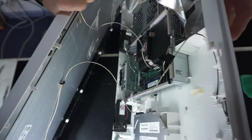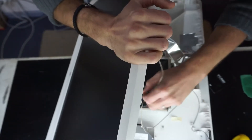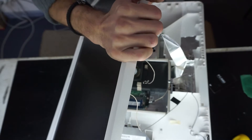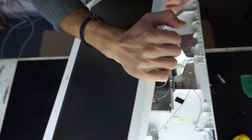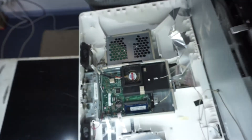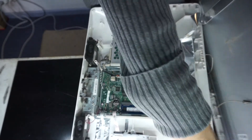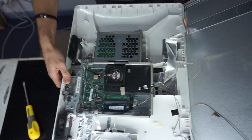You should just be able to wiggle that loose to disconnect it. Even though the ribbon cable going to the display looks like it's twisted, that is how it is from the factory, so don't be too alarmed by how crinkled it looks. In this instance I did leave it connected but was able to fold it underneath the back.